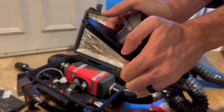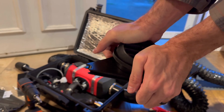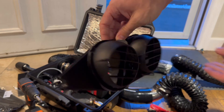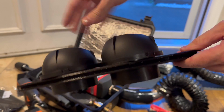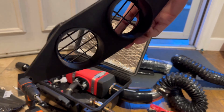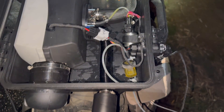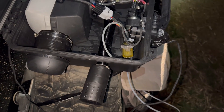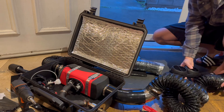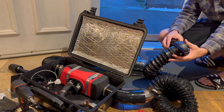Previously, I was just putting the end of the outlet hose into the tent, and that really doesn't create a nice seal or keep out the wind and cold. These outlets allow you to seal off that opening a lot better, and they also rotate so you can control the direction of airflow. The main efficiency gain with this new setup is that instead of taking air in directly from outside, heating it, and sending it into the tent, you can actually just reheat the air that's already in the tent.